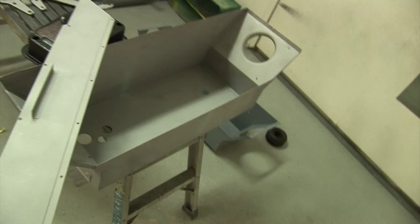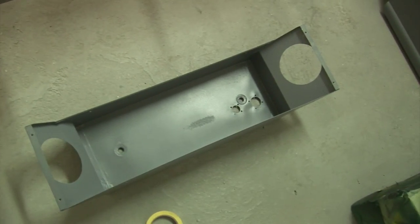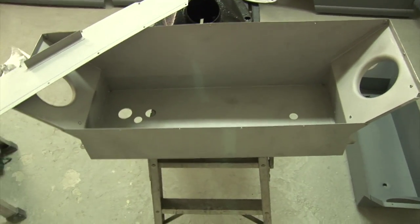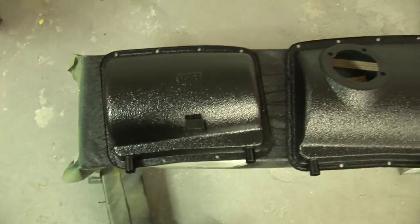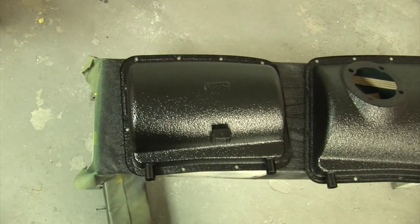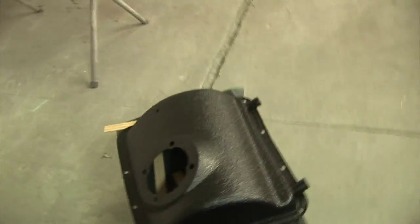Here are the other pieces of the ductwork — they've been glass beaded and I'm getting ready to hang them. That piece has been put into epoxy already; nothing else is going to be done to it. It holds the coil and everything in it and fits inside the assembly. These are the fronts on the firewall. The texture coating going back on is from a bed liner epoxy spray — activated spray — which makes a real nice finish and gives good insulation.